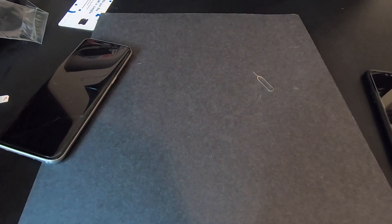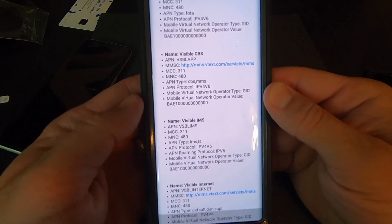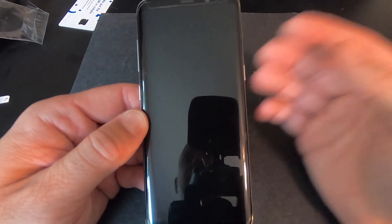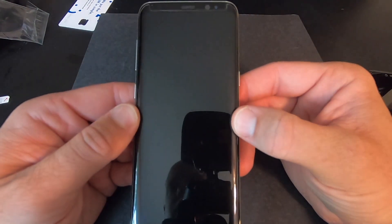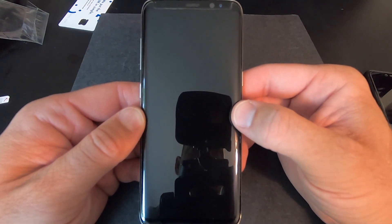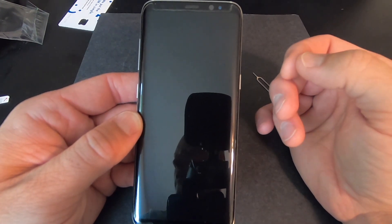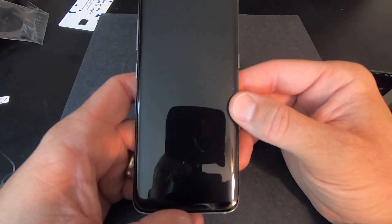There was one article I found on Reddit that actually got it right, and there are four different sets of APN settings that have to be entered on what we'll call incompatible phones. The reason my S8 did not update correctly was because the software stopped with Android 9 — there haven't been any updates. Visible came out after this update was done, so the phone just didn't know what to do with the SIM card. We have to manually tell it what to do. This will come into play mostly with Android phones. I also had an unlocked S9 that I had to do the same thing to — I was able to flash it with updated firmware and then it could read the SIM card by itself.